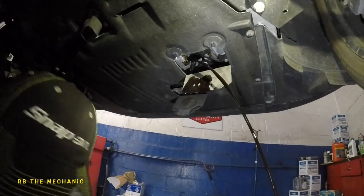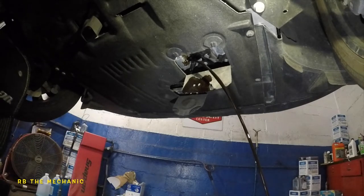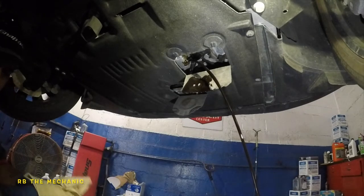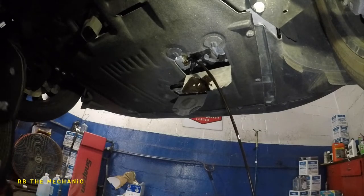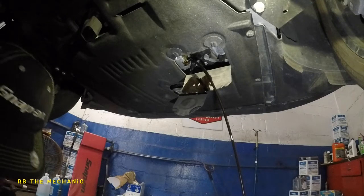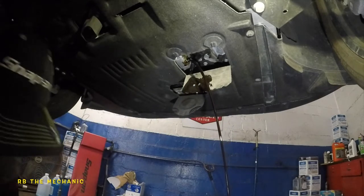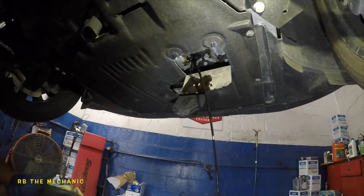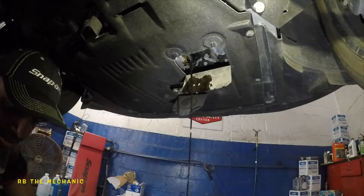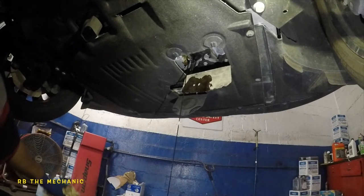Got my drainer and the little washer. We're going to give it a good 20 minutes so this baby can drain out. Meanwhile, inspect your drain plug and get the new crush washer. Usually you will get that stuff inside the filter housing, but you can reuse the old one too. There's our crush washer and new drain plug. After draining, wipe down any excessive oil — you don't want oil dripping in your customer's driveway.